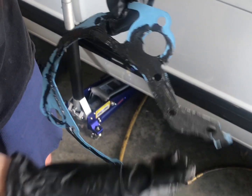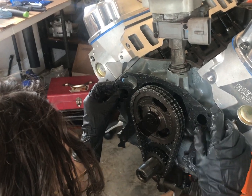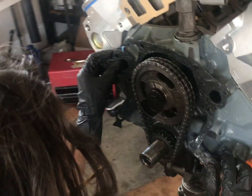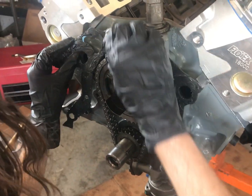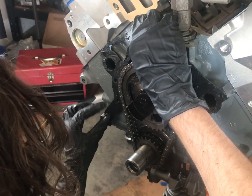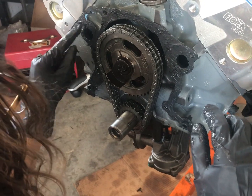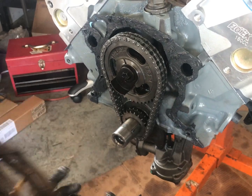He's just going to smooch it around - I found that seems to work really well. Once he has this smooched on both sides, we're going to stick it to the block first. Those locating dowels aren't there just to secure the gasket. They're really there to center the timing cover, because when the cover's not centered, you'll have an irregular wear pattern on the balancer seal and it'll leak. That looks really good.